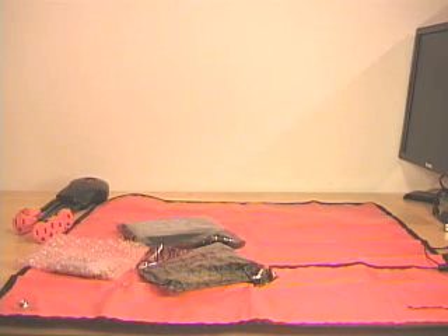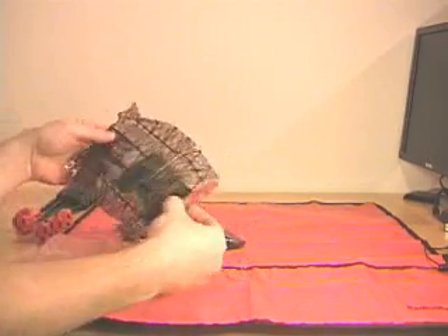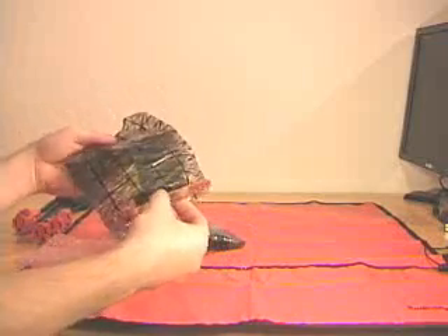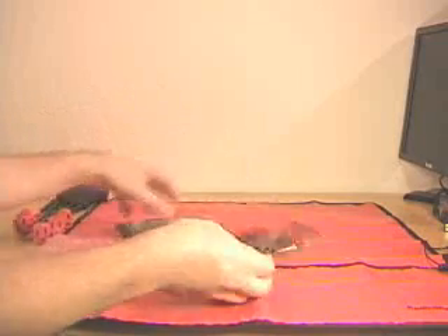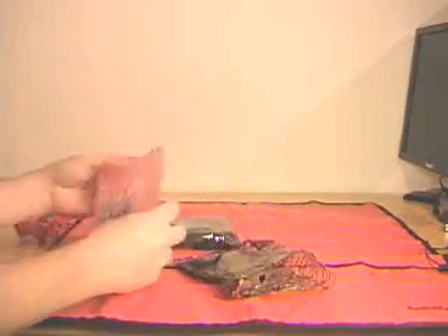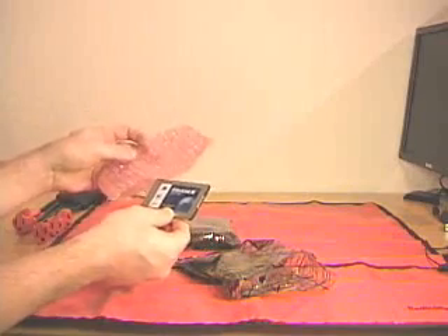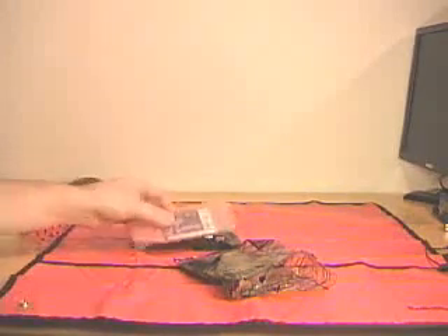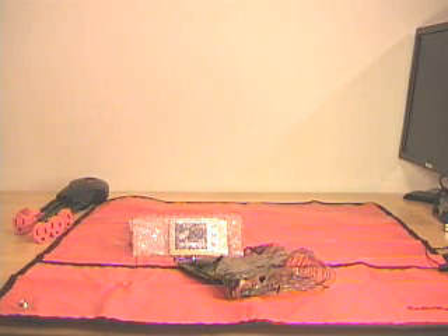One final anti-static measure that I recommend you use are anti-static bags. When you purchase a component, it generally comes inside an anti-static bag. You should leave the components inside the bag until you need to use them. If you have components such as an I/O card, hard drives, or a PCMCIA card in an anti-static bubble bag, you can put them inside these bags to prevent damage while taking components out. Or if you purchase new components that come inside an anti-static bag, leave them inside the bag until you actually need to put the component inside the computer.